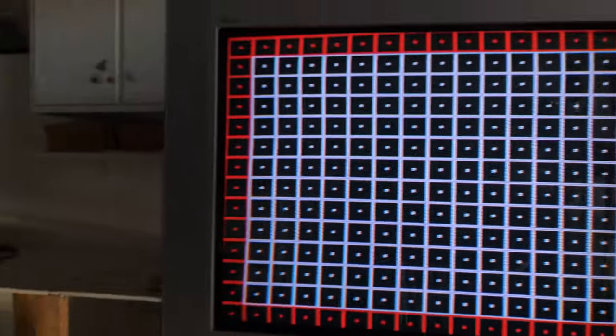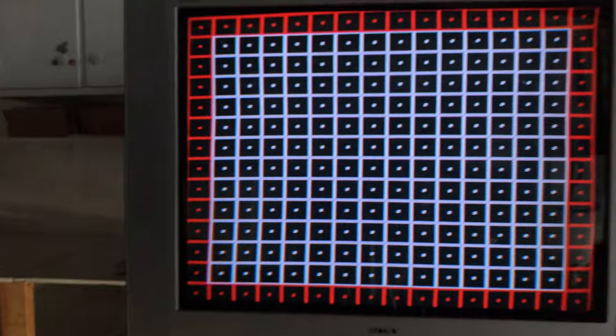Along the vertical axis here in the corner it's still off a little bit, but it was worse. I kind of spread that out over the whole screen — if you look now, even in the center you can see vertically the red and the blue gun are off a little bit. There's still convergence over the whole screen that's a little bit off, but it's not as bad as it was in that one corner. Even right here where you can see it's off a little bit — that's nothing you're going to notice when playing.